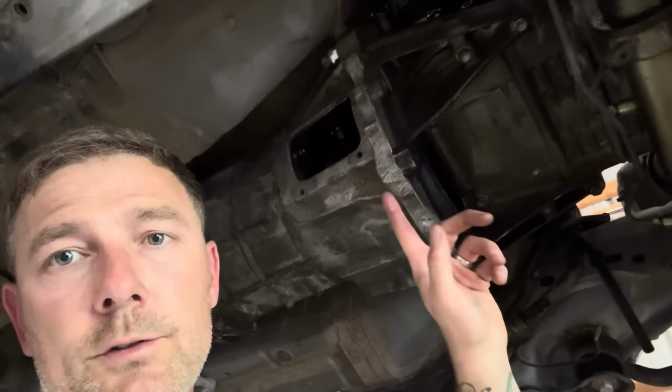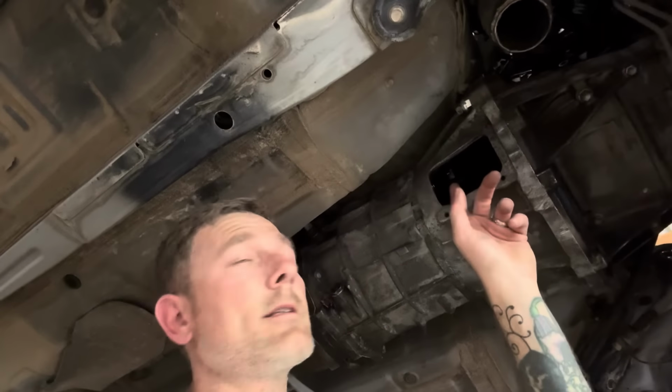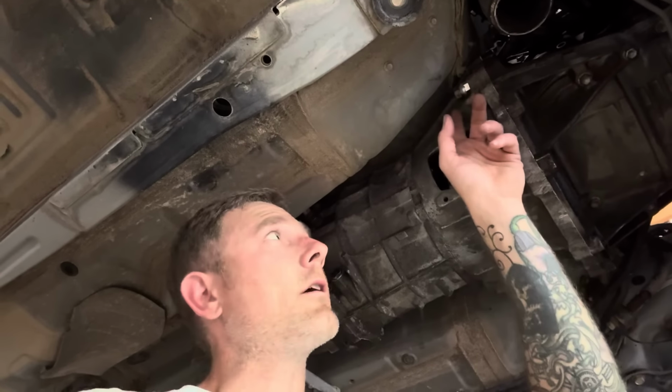And I've got 2 bolts holding the transmission to the motor. I can go ahead and eyeball where these lines can come out, if I can snake them through here and get up to the clutch master, or if I have room to go straight up through the top. So I need to figure that out now. Well, I got it bolted in, so that way I can have Excessive make me the lines. It'll be a line to go to the master and then a bleeder line. That way it'll have a remote bleeder up by the master as well to make it easy to bleed, so we don't have to get under the car to crack it. So I'm going to do some poking around and see which way I want to run these lines.